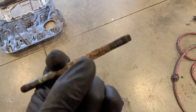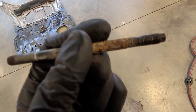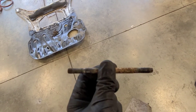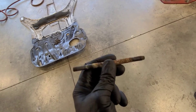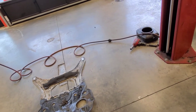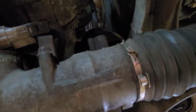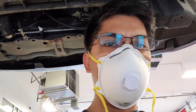You're supposed to slide the compressor that way, but once I took the nut off, I took the stud off too. If you can get lucky removing the studs on this compressor, that 9 to 10 hour job — you'll save about eight hours. Instead of ten hours, you can probably do it in about two. I'm about to take the other two on top on the other side, and if that works, it should be out. If not, I'd have no choice but to drop the subframe. You get the idea of where we're going — I'll keep you updated.